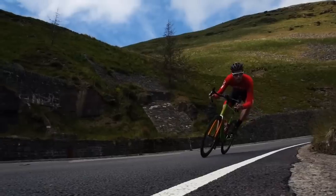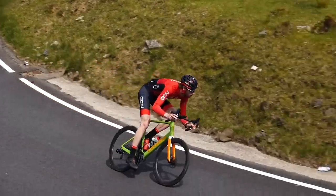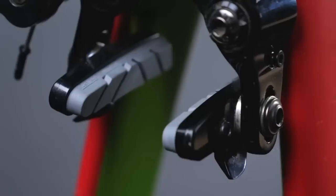The next tip is all down to you, the rider, because through improper use, even the best or most well-maintained brakes aren't going to work correctly if you don't use them correctly. This is mostly going to be apparent on really long, testing descents such as making your way down a mountainside. If you're dragging the brake continually, this is going to cause excessive heat to build up in the system — the same for rim brakes and disc brakes. Excessive heat buildup is going to cause glazing of the brake pads and the rotor or rim brake surface, causing you to have to apply additional force through the brake lever, which in turn generates even more heat. For a disc brake bike, that excessive heat could eventually lead to the boiling of the brake fluid itself, giving your brake pretty much zero effectiveness at slowing you down. For a rim brake bike, the excessive heat buildup and glazing could eventually cause the brake pad to stick onto the rim surface, or in the instance of a carbon rim, start to cause the carbon to delaminate — something you really want to avoid.